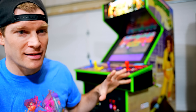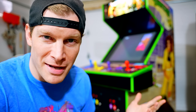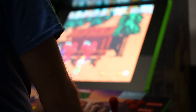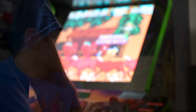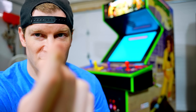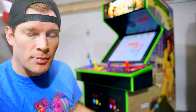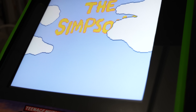I didn't really want to mess with drilling holes for coins on the coin door, and I didn't want coin mechs because this is free play — it's set up at my house. I don't want to have to put quarters in or open the coin door and hit the mechanism every time I want to start a game. So what I did was install a couple of small single push-button switches underneath the control panel. I've got one for each player, configured so that start and coin are the same thing. Double tap it a couple of times for each player and you start the game. I've got a fifth one in the dead center that is my escape and back button, so anytime I want to get out of the game and pick another game, I just simply do that.